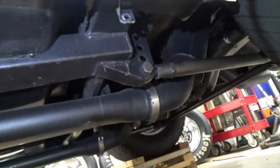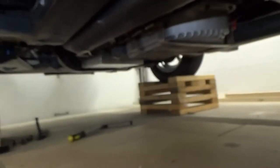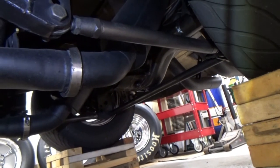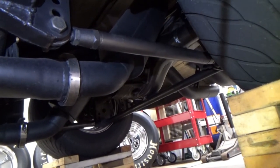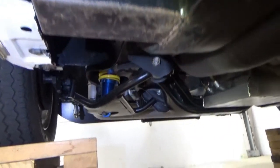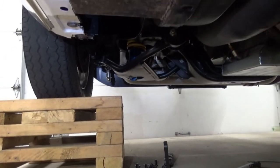Under the car you can see it has full frame rails, a full 12-point roll cage, and a four-link out back. The Turbo 400 transmission is in there, and it's a nine-inch Ford rear end — a fully braced nine-inch. We run AFCO double-adjustable coilovers on the front and Koni single-adjustable coilovers in the back.